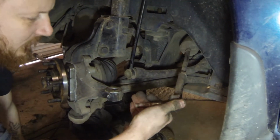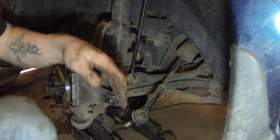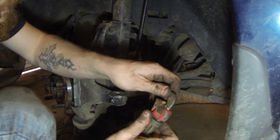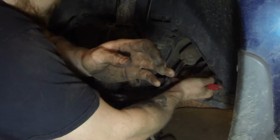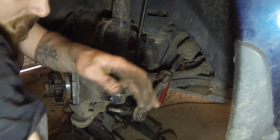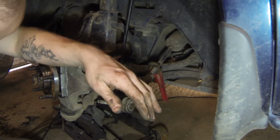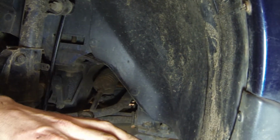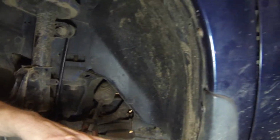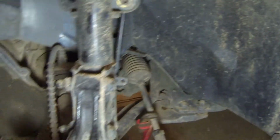Alright, so now that that's out, we'll put a little pipe wrench on the back side, and then we can start counting the turns so we can put the other one on roughly as close as we can get to where that one is. Now the way I do it, James, is I'll snug that locking nut up against it. That way, even if the turn ratio is a little bit off, you want to hold the camera, I'll do it. Dude, my knuckle, I can't feel it. Alright, here, step back there. Make sure you get a good shot of it.